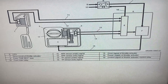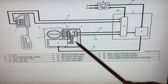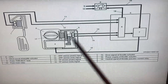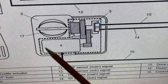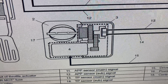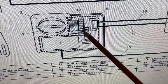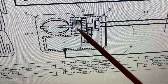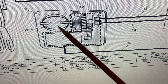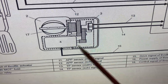It's really a servo valve — it applies torque to the drivetrain in order to open or close the throttle plate. It's important to realize that right on the throttle assembly there's a bias spring, which actually consists of two different springs: a return spring, just like an old-school carburetor, and also an open spring which maintains the throttle plate in a default open position when it's unpowered.